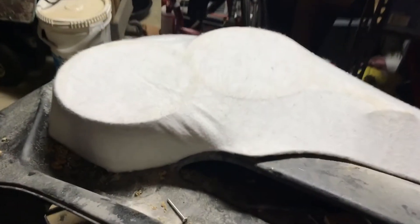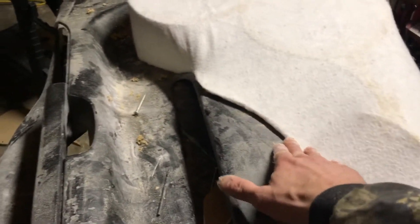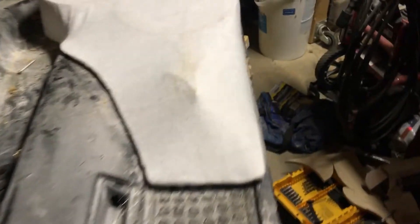I got the fiberglass molds cut for both doors. I got one door's baffles done and some material stretched over it, as you can see here. I'm not too worried about any of the little wrinkles in the side — once it's resined over cloth, sanded, and a little bit of bondo it'll be good. I'm gonna get some fiberglass bondo putty to go around here once it's actually in place and screwed into the door, fill all that in, then take it back off, sand it, wrap it, or paint it.